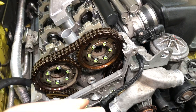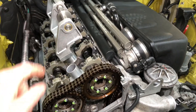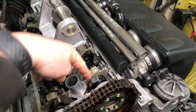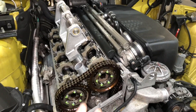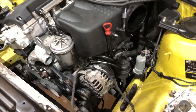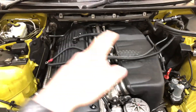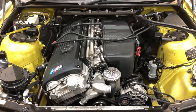We're getting ready to put the helical gear sets in, take that tool off, put the other timing tool on which goes in and holds the cams correct. When the inlet cam comes round, the holes will be visible, we can time the cams, and then get the Vanos system on next. We're nearing completion now - a lot more is built up. Still need radiator hoses, fan, fan cowling, air box, inlet, and pollen filter housings, but it's all coming together very nicely, looking neat and clean as we reassemble. Very soon we'll be going for a first start.